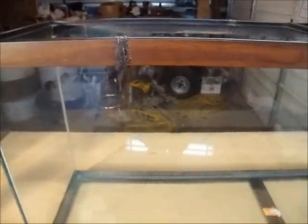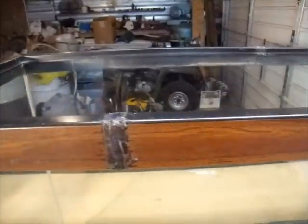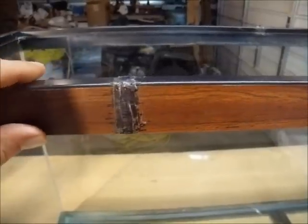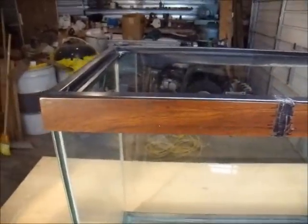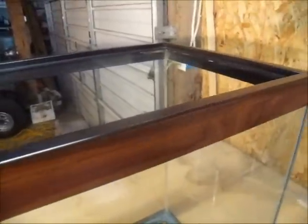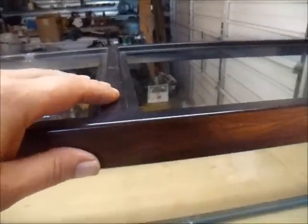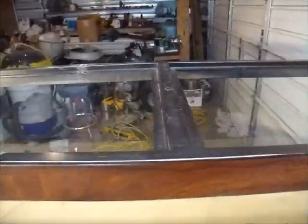Let me tell you a little bit about the tank. The tank didn't have any leaks in it at all. The cracks up here were from when it was really cold — I grabbed it to move the tank and when I grabbed it I broke it. That's what the crack was from; it wasn't from cold water or anything like that. But this trim ring is important to your tank. This is a 55-gallon, and this center support brace holds the pressure on the glass. You can't remove that.